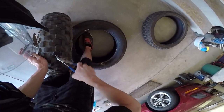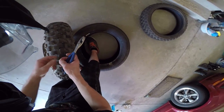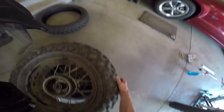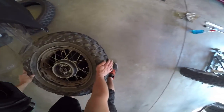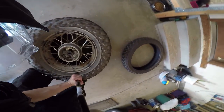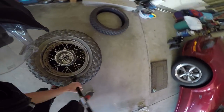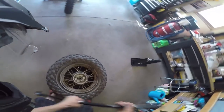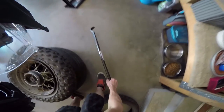Before I take the inner tube out I'm going to rip this nail out. Damn, that went through the entire knob. I'm going to use a car tire to set this on top of — it helps protect the sprocket and brake assembly and keeps it from wobbling around. I've got a bead breaker; it's probably overkill for this tire but let's see. Once you get it broken it just kind of pops down — definitely break the bead on both sides of the tire to make things easier.